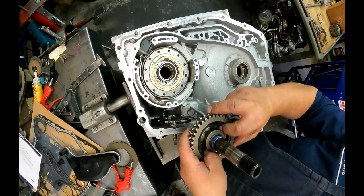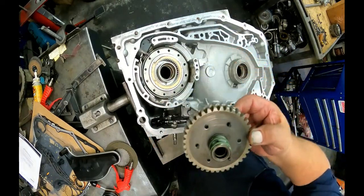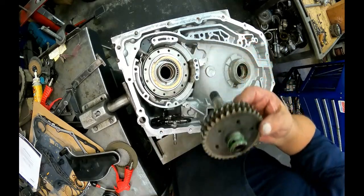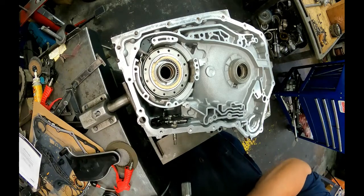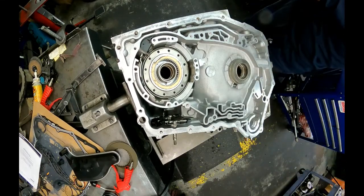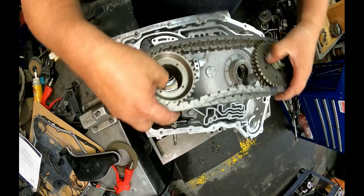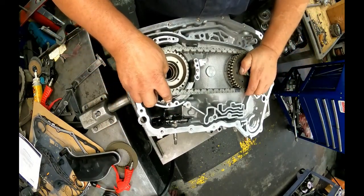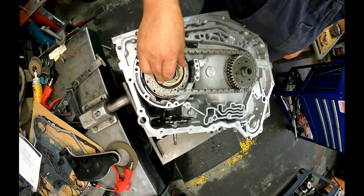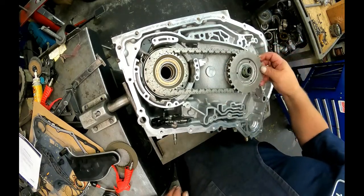We got ones that have long tabs and short tabs. See how far up it's sticking. If you got the long tabs, you gotta make sure that your rotor fits properly on here. Because if it doesn't, you're gonna have to grind those tabs down. Alright, blue links up. Four tab washer. Our rotor, don't never forget that.